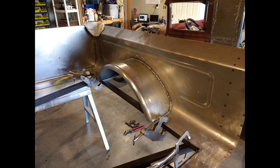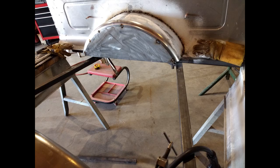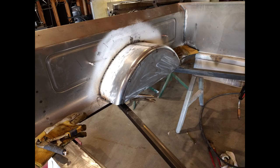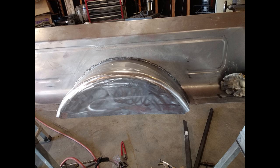There's one side tacked in, and then I'm making my flat panel that goes on the back of the fenders — that worked out pretty good. The fenders are thick enough that you don't have to worry about them warping, but you've got to be real careful about welding these. I just go maybe half an inch at a time and then move somewhere else; you don't want it to get warm.